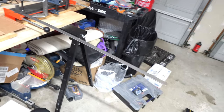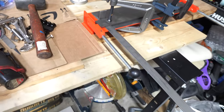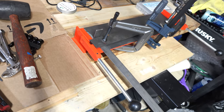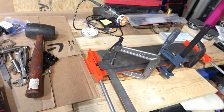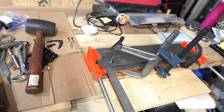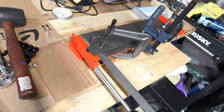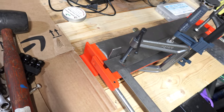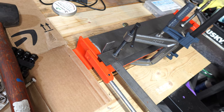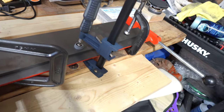Alright, so here we go. I'm in the process of making that second bracket. I just got this 1/8 inch steel on this bending brake here. This bending brake says you can bend up to 18 gauge. This is 1/8 inch, so this is maybe a couple notches thicker, but you can still make it work. You may have to try it a couple times. You may get it about a 45 degree angle, then you come back again for the full 90.